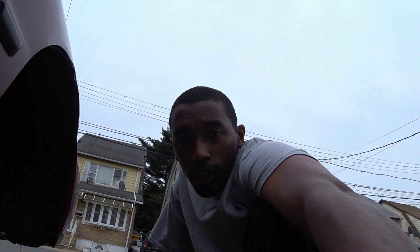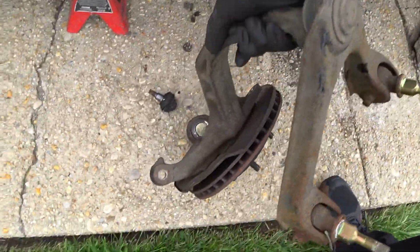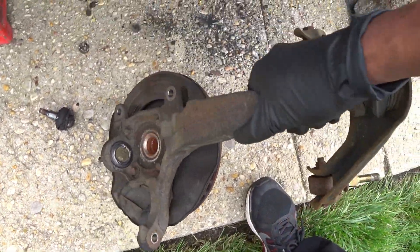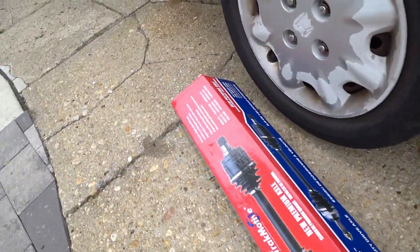Back home now — none of the shops are open, so I just had to go to my boy's house. Luckily he was close. We have the axle out and you can see the new ball joint is in. We're going to install this over here, but first I'm going to try to get the axle in. The axle fits through this opening so I don't have to take the whole thing out — just going to pop that little axle out in the back and I should be good to go.